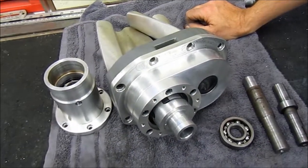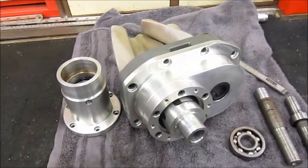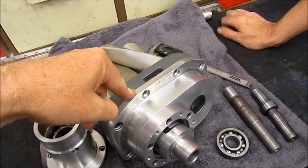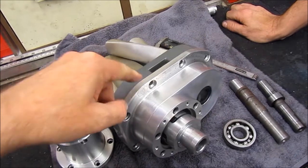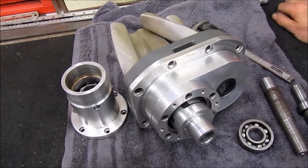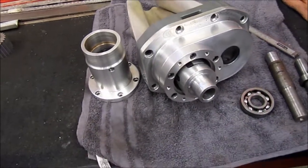The sad news is that the M90 may be too big for the bike. This is the third supercharger attempt — the first was too small, and the second was a Sprintex. Both previous ones didn't work well because they were run dry; Sprintex units are pretty much useless if you don't run any fuel through them.